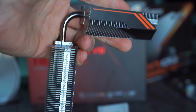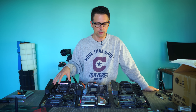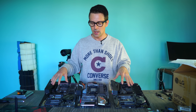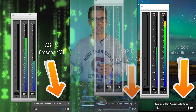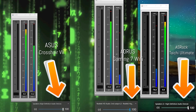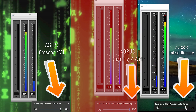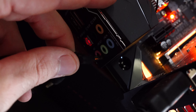These motherboards being as expensive as they are, one must wonder about audio. Moving on to crosstalk — the Crosshair 7 and the ASRock Taichi Ultimate both had really good crosstalk, however that was below a volume level of 91. As soon as you go over 91, it introduces some slight leakage into the right channels. For the best listening experience, leave your volume under 90 on these two motherboards. The Gigabyte board had an issue where I couldn't get audio from the rear output, so I had to use the front audio output — but there was really low crosstalk down to near minus 90 dB, same as the other two solutions.